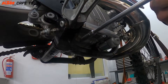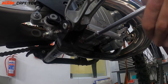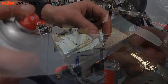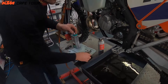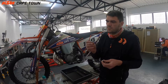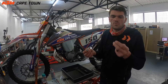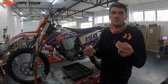On all the 125s and 150s, they actually have a drain plug on both sides of the engine casing, whereas the bigger bikes do not have that. After cleaning with some brake cleaner and putting on new copper washers, the big drain plug with the magnet goes in at 20 Newton meters of torque, and the small drain plug goes in at 15 Newton meters of torque.